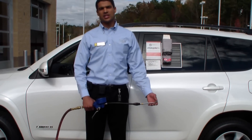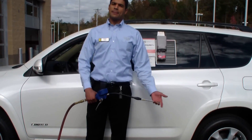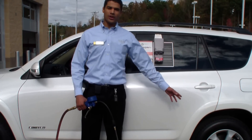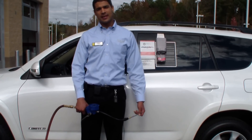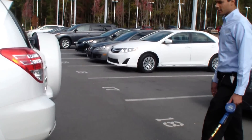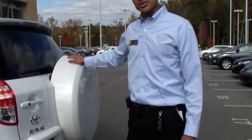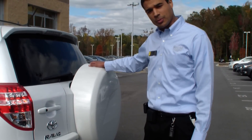Whether you're at home or at a service station, if you don't see a tire that's visibly low like the one in our example, make sure you check all of your tires for proper pressure. With this RAV4, you want all tires to be at 32 pounds per square inch, or 32 PSI. Also, remember that if you have a RAV4, Highlander, other SUV, or truck, you may have a full-size spare that also has a pressure monitor in it. You want to check that as well, because it could also trigger your low-pressure tire light.